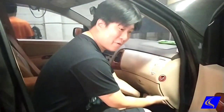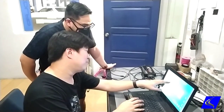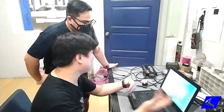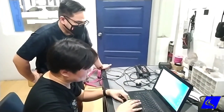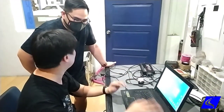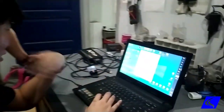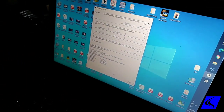Every Fortuner, Innova, and Hilux ECU is located behind the glove compartment. Take the glove compartment out, take a picture of the ECU sticker, and message it to me on Facebook. I can then tell you whether it can be remapped or whether only a Unichip will work for your car. It's a bin file — binary — you can open it in Microsoft Word but it'll come out as garbage. There are two kinds of software used for remapping: a reader-writer, and an editor. This is the reader-writer, so its job is just to read and write.